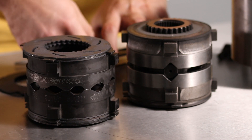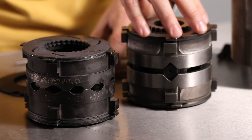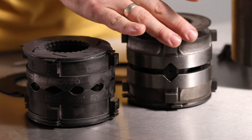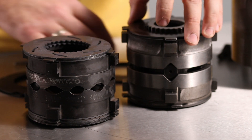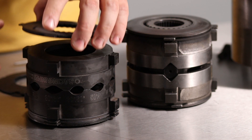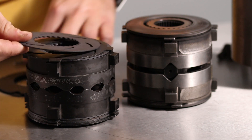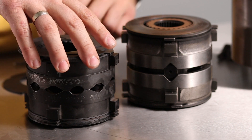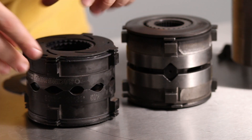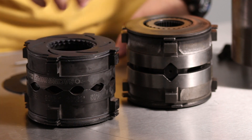The second advantage is the number of plates itself. In the factory setup you have one dog ear plate and one clutch plate per side, so two in total. In the RacingDivs Max Performance pack you have double the amount — two clutch plates and two dog ear plates per side — which is why we are able to offer a full lifetime warranty on the plates within this pack.